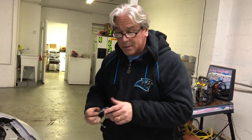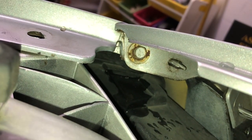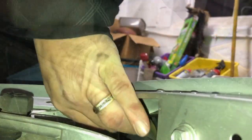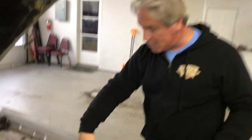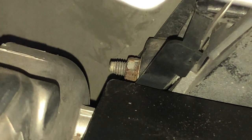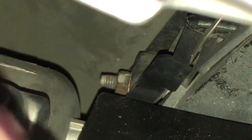Unlike most other cars like the Chrysler 300, the Dodge Charger has two extra bolts — one right here where my finger is and another one on the other side. Both are 10 millimeters and you'll need an extension. There's also an extra nut on the inside of the fender well right there — I'll zoom in on that. You have to take that off too; it's just a nut, not the whole screw. You can get it by going inside the fender well since you already have that off, pulling down the water shield — you'll see it right there.